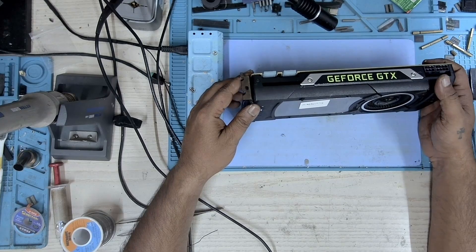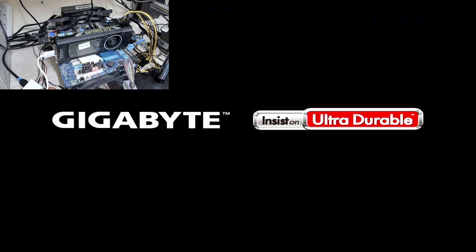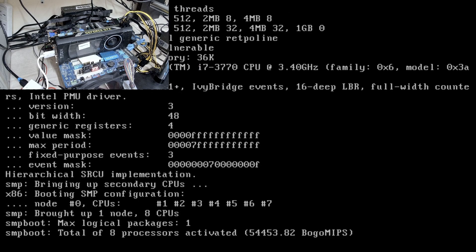Let's put this card on the bench and check if we have any memory errors. I'm going to run MATS. The card is already on the bench now, so let's run MATS and see if it fails. I'm sure it's going to fail because the user said that it artifacts and the retail store has already put a sticker there. Let's boot the card up. It's already taking a long time to show an image — finally we have an image. That was approximately more than about 30 seconds.